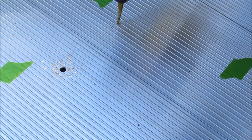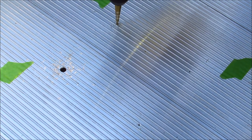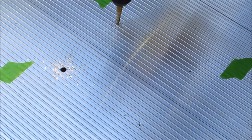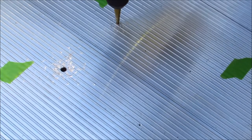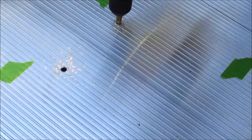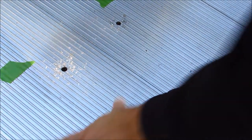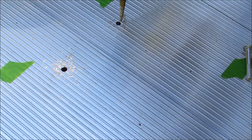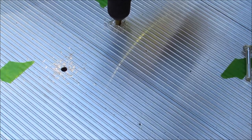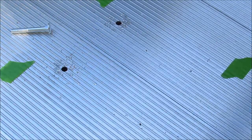All right, so the stepper drill worked pretty good. I'm going to show you on this one. You go to the last step and it made it just big enough, but that small pilot hole seemed to work. So we'll drill out the next one, show you how easy it is. Not putting a whole lot of pressure on the drill. Once you get that first notch in, they start going pretty quick. Nope, one more, so it does go all the way to the last one. And we got our hole in good shape. I'll finish drilling these and we'll be back.